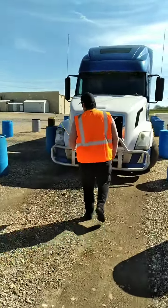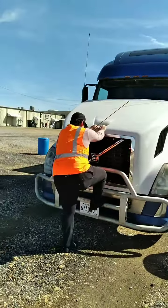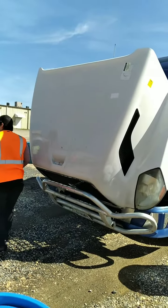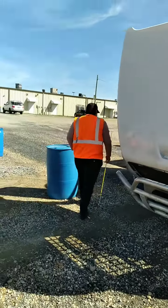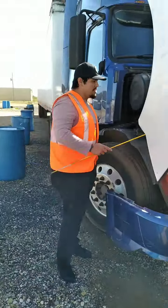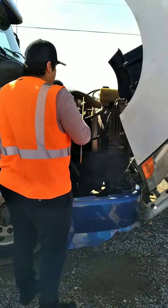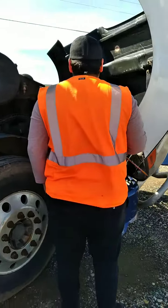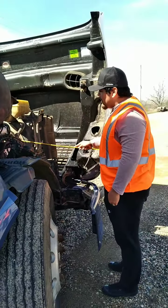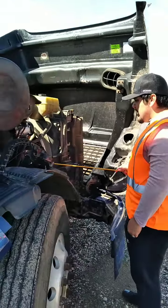Now I'm gonna move to the truck and open the hood with three points of contact — two hands and one foot. Over here on the passenger side, we're gonna check all of our general hoses — they're properly mounted, secured, free of abrasions, bulges, and cuts, and not leaking any fluid from either end. Now we're gonna move to our fan — it's properly mounted, secured, not cracked, bent, or broken, and we're gonna check that it's not missing any fins.